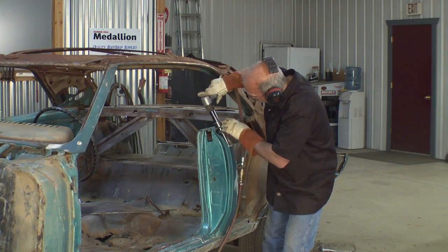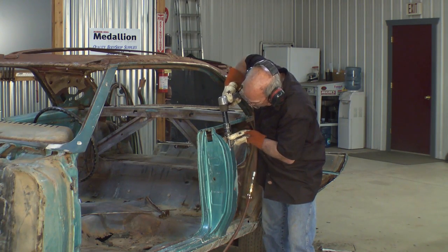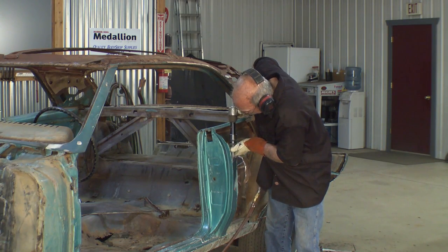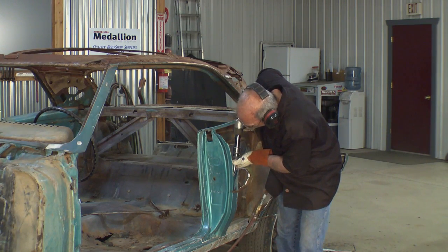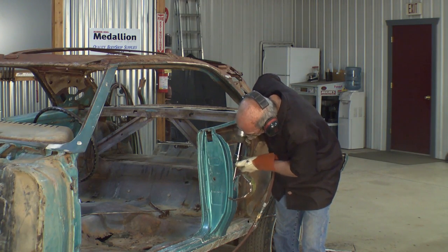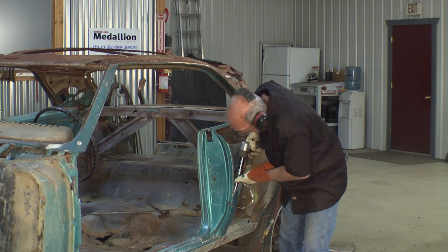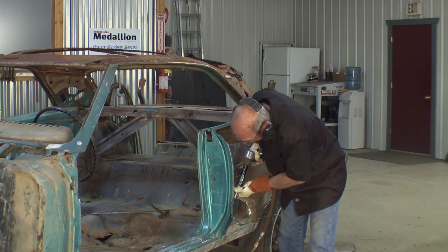Watch what I'm doing with the chisel right here. I'm using the edge as a guide and I'm just peeling the quarter panel off. The object is the single plane metal because it's spot welded down through the face. I'm running the chisel right along that inner structure as a guide. It takes a little bit of time — see how I can fold the metal back. That's the single plane doing what I want it to do, folding out of the way, so I can get on that face and remove the spot welds.